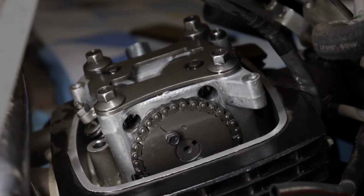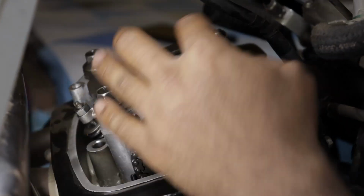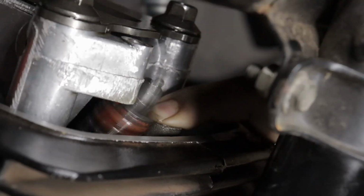My material of choice would probably be phosphor bronze, because it's a bearing material. It wouldn't harm the aluminum rocker arm cage or the steel rocker arms. It wouldn't harm any one of those. Or I should use a Teflon one. Teflon, a very high temperature plastic, has great lubricating properties. It's used as a bushing in some applications, so I think Teflon washers would be good.